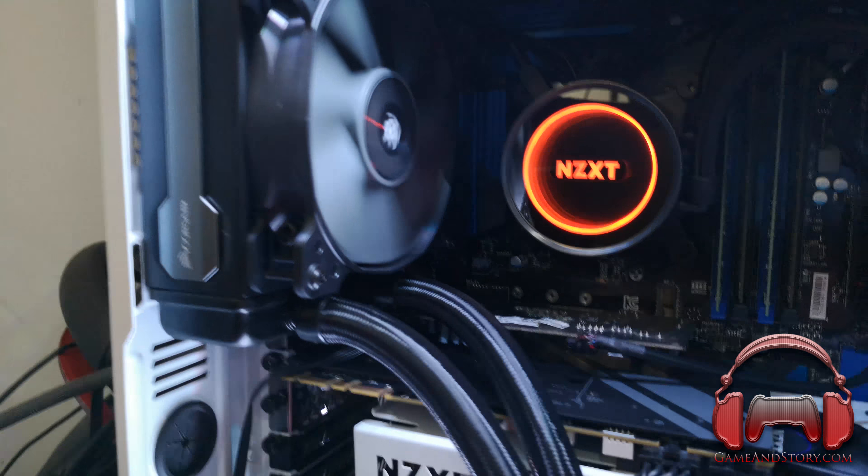We've had some compromises in terms of placement of cables — this is the best that I could do. There's a whole mess of cables here that you guys can't really see, but that was quite a challenge. Basically I just shoved everything in, and once the case is on you can't really see them, so if it's not there, it's not really a problem. In order to run this fan header all the way up to the CPU 2 header, I've had to use a fan extension cable which I just happened to have lying around. If you try to do it by itself, it's probably not going to reach. The alternative was actually to go to the system fan header, which is usually used for the exhaust fan on the back of the case — so this is probably the best compromise so far for layout in terms of airflow.